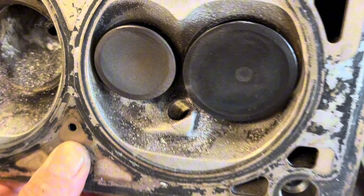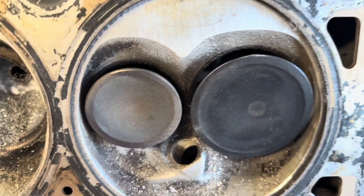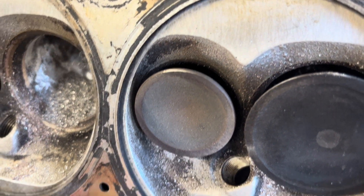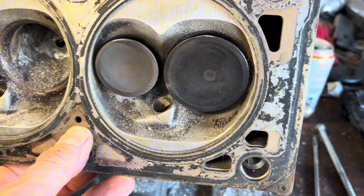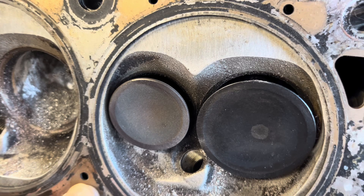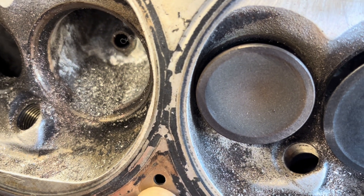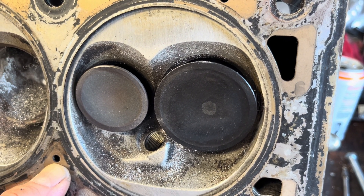So this is what I'm talking about — I've got the head gasket in this area here, so I'll be able to take a sharpie and mark that. The valves are kind of shrouded by the sides of the cylinder head, so if we could open that up just right up to the line. Now obviously if you have a 5.3, 5.7, or 4.8, whatever — this is a 6-liter block I'm using with a 4-inch bore — if you do have one of those smaller engines you probably do not want to do this. On a 6-liter I'm going to open this up just a little bit, get another 1/16th to 1/8th of an inch in here, and I think it should help. I'm going to have way too much compression; this is going to be a turbo engine with 10-to-1 compression using these LS1 heads.